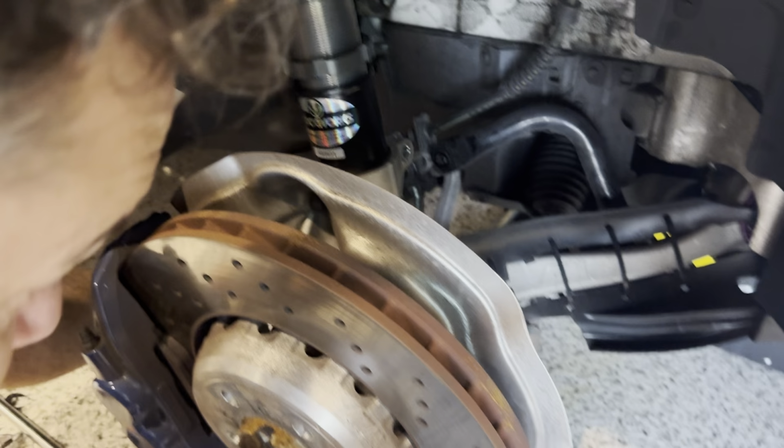So we'll start unbolting things on the strut top. Because we've got the camber plates, these are all just a hex socket. But that's a big E14, E18, sorry. And then we'll undo that. So we're going to take this shock out in one whole unit. We're not going to separate the camber plate from it, so we can put it back in if need be later. So we'll take this off and then pull these off.